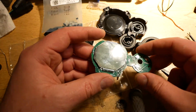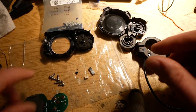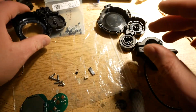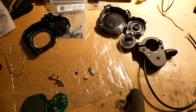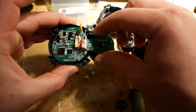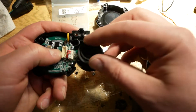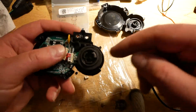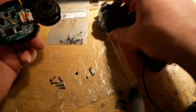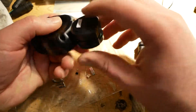Once it's all done, you'll see your LCD has probably got fingerprints all over it, so clean that up with a little bit of alcohol, glass cleaner, or a clean paper towel — otherwise you'll be looking at them through the plastic. If you've touched the inside of the cover, clean that up too. Then the board drops back in with the little connector. Put the disc piece back in, put that screw in to retain everything. You'll want to cut a small channel somewhere to bring the wires out for your throttle so you can plug it in. Then plug in your main cable back to the scooter, put the back cover on, put all your screws back in, and you're done. This will work exactly like the hook throttle does — except now you'll have an external twist or thumb throttle that works exactly the same.